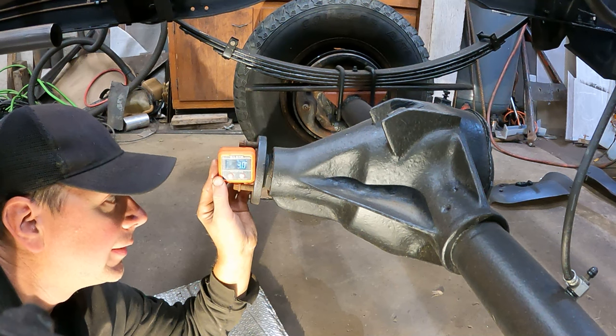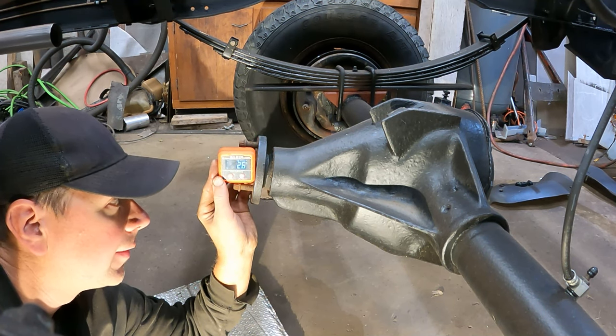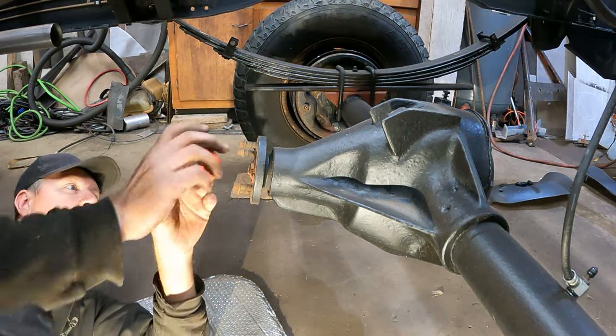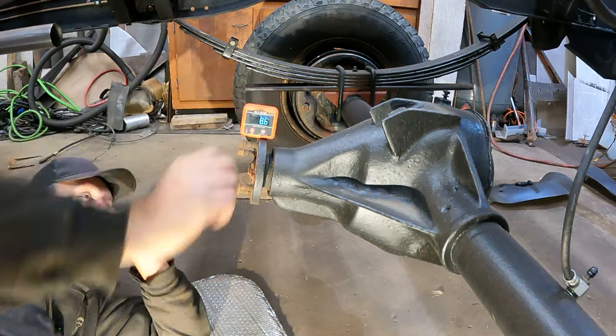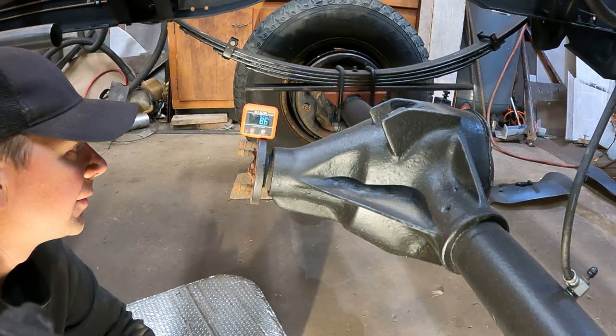I set the front of the truck down so we can see the transfer case is at two degrees down. We've got 8.7, 8.8 — so the rear end needs to tip down. We need to tip it down right about there. So what I need to do — 8.6, that's close. Let me climb back under here, loosen up the U-bolts, and I stuck a little shim under here. Let's get a start and see where we're at with our angle of our dangle here. We came down two degrees.